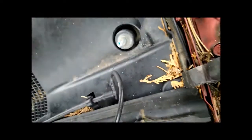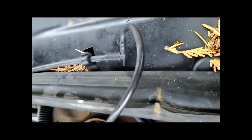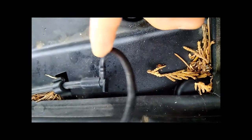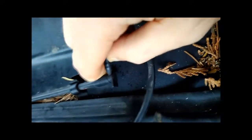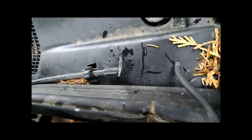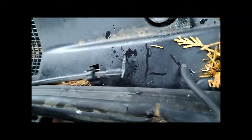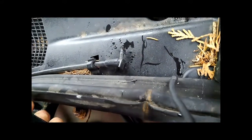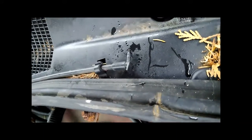Before we can install the new arm, we need to disconnect the hose that goes to the fluid. The new wiper arm just has a hose that goes up to one point, so we're going to disconnect that — just pull it off. It's probably a two-hand job, but it's not too hard. Just pull it off and it comes right apart. Now the entire wiper arm and wiper blade sub-assembly is free, so I can remove it and replace it with the new wiper arm.